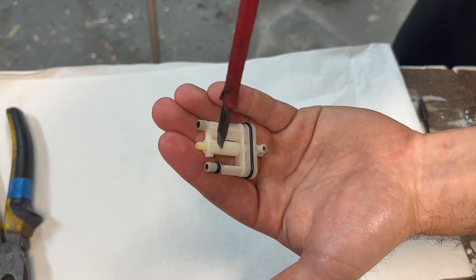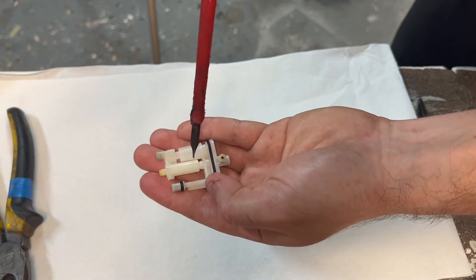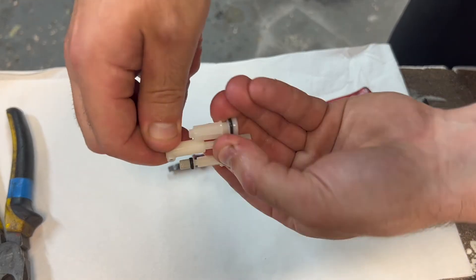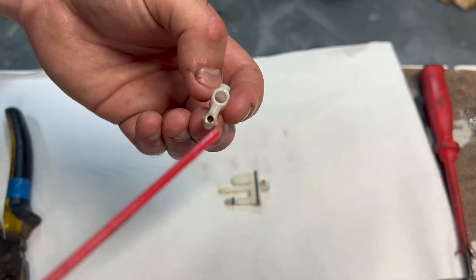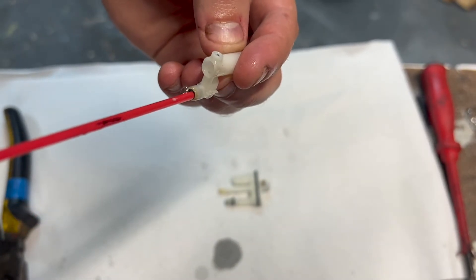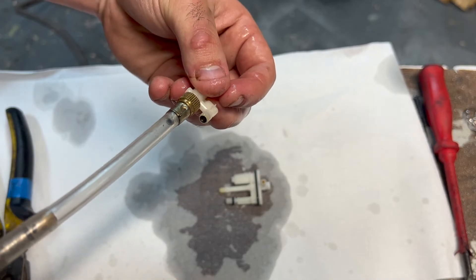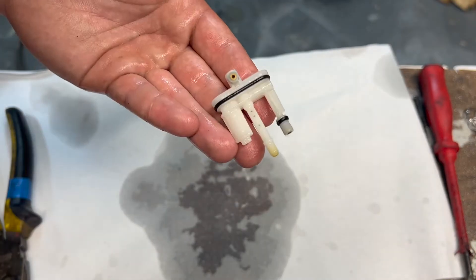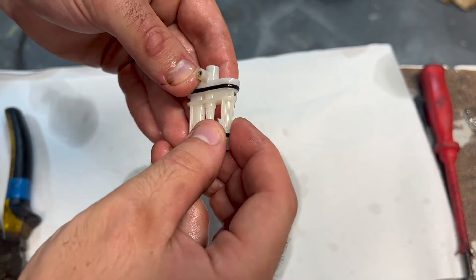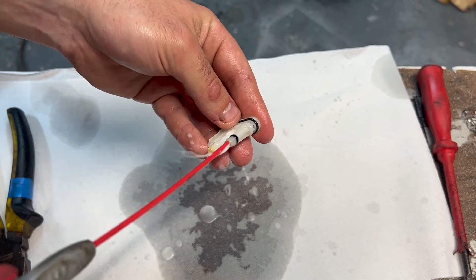This is the main jet; you've got a pilot jet. You just need to strip this apart — just get a screwdriver in here, give it a twist to separate this piece. Let's start with this piece — you see this hole inside here, just get some spray and make sure that's clear. And if you've got some compressed air, just blow that through as well. Now we've got to clean this piece. If you're using carb spray, just be careful of these rubber seals because carb spray is quite aggressive and it could damage them, so it's worth taking these off. Spray up in here and make sure all the holes are nice and clear.